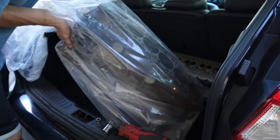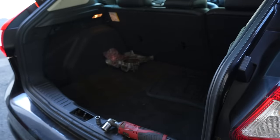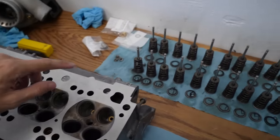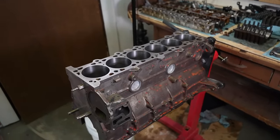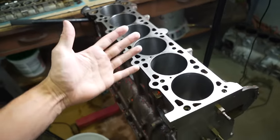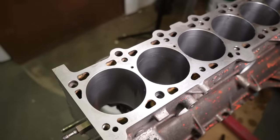A quick look at the head — this is an M52 head. All I had done to it was getting the deck done, and I lapped all the valves on my own. Now it's reassembly time. Here I have the block back from the machine shop. The machine shop recommended coming in with soapy water to wipe all the cylinders down to make sure they're completely clean. Their cleaning machine doesn't get it as clean as you'd want before a rebuild, so I want to clean it very well. After that, I can coat the cylinder walls in the break-in oil.